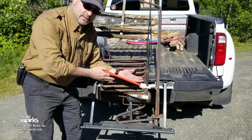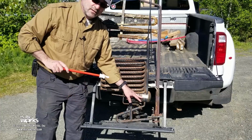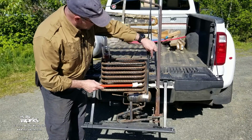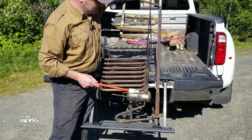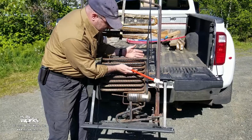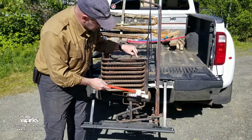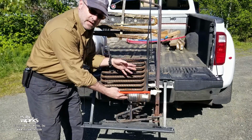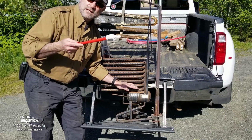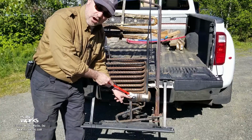And that vapor, because it's gonna be lighter, it's gonna start working its way up. As that ammonia is absorbed into this water down here, the hydrogen is free to return. So the hydrogen can come back up here. The hydrogen wants to get back to this tube right here, and it works its way back up the tube, back up to the top. So the hydrogen loop does that. The hydrogen ammonia vapor that didn't do that is working its way back up here. The water that we left off is coming around this tube here to join in. So as the vapor's going up, the water's going down, okay? Two ships passing. And as that ammonia passes through that water, remember, the ammonia readily absorbs into the water. And now we're back where we started again.